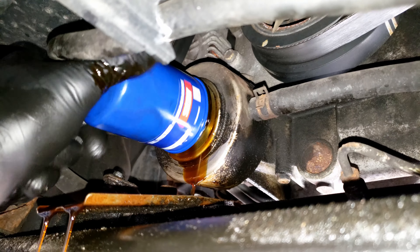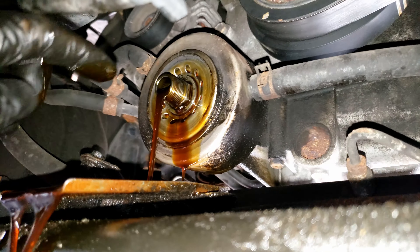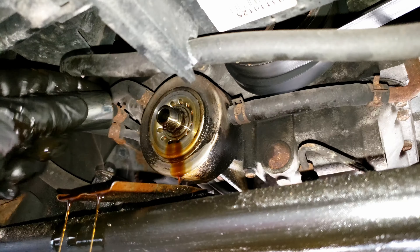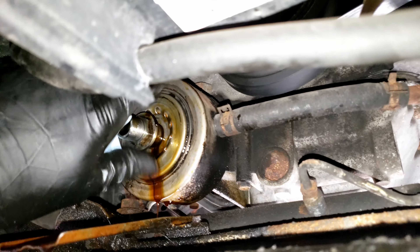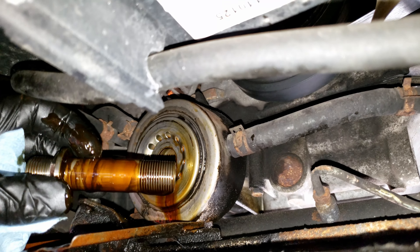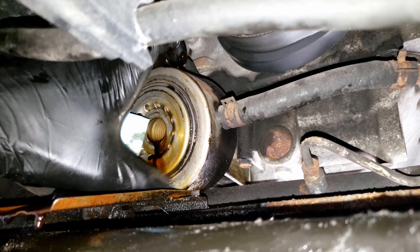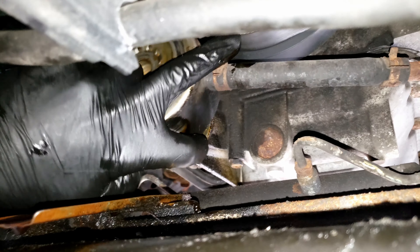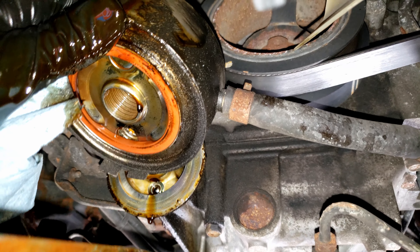What the oil filter threads into is the oil cooler, and behind that there's an o-ring that's notorious for leaking. Pop that out, and then you're going to remove this stud, which is a 7/8 or 22 millimeter. Once you loosen that, you can pull the entire stud out and put it somewhere safe, and right behind it — see how much room we can get — is the o-ring I'm talking about.